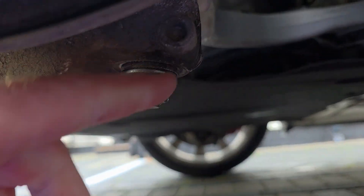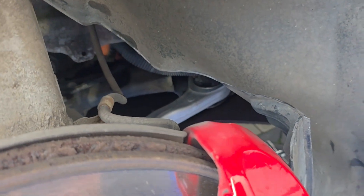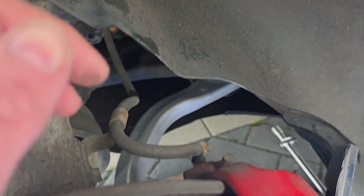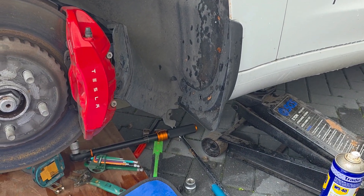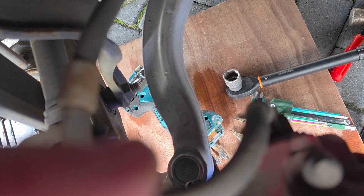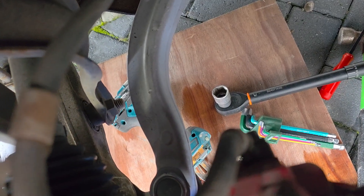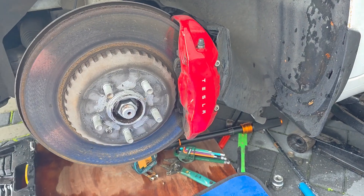As I said, I'll be getting a new nut - it's temporary as the car's going for an MOT tomorrow, so I've got to order one today and this will have to be redone. A few pointers: it's worth releasing some of the plastic - you don't have to take it off completely, but it will make it easier. If you can jack the car up even higher it'll also help. Once you get one end in, it feels unnatural to keep pushing down to get it into the hole at the back, but it will go. Once you push down far enough you can get the nut underneath and tighten up. The manual recommends tightening that end first, then the other side.